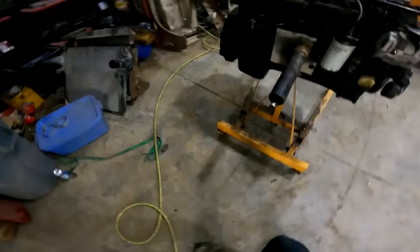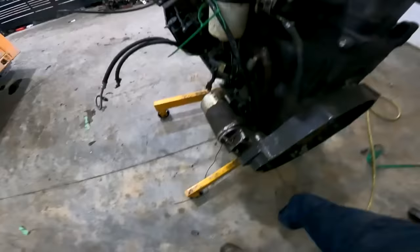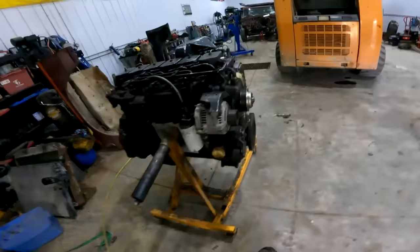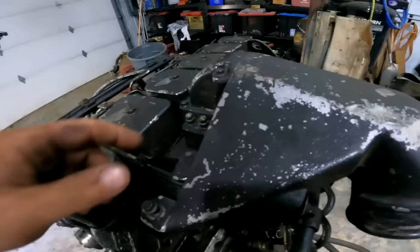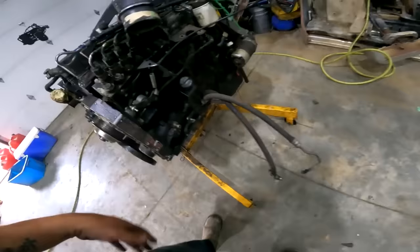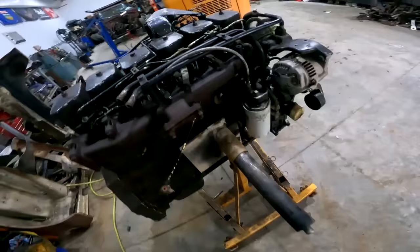Not even that drunk. All right, so this old pile of Cummins has to be running before we put her in there. We've got to hear it run, if for no other reason than to hear it run. I knew it ran good when I first bought it, but that was 5 years ago. So I filled the whole engine full of oil. I pulled the intake off, poured a pile of oil in there, turned it 180, and then, not with the starter, waited till it started puking oil out, and then poured oil in again. So she's been waterlogged with oil for a long time to prevent rust. We've got to get that out of there, then tighten the injection pump down and get her to fire.